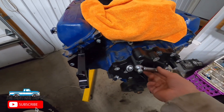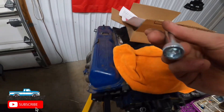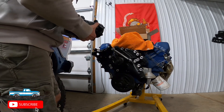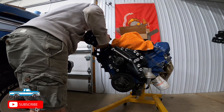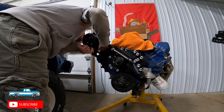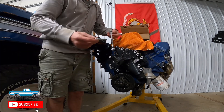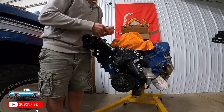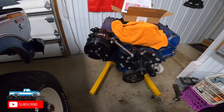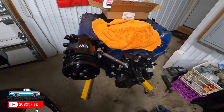I just have that on hand tight right there. This is the other bracket that goes up once you have the compressor on — and then the long bolt that's going to go into the bottom of the compressor. For right now I'm installing the compressor with the lines facing away from the engine. Now I'm using the one bolt that's left to attach the final support bracket, leaving it loose for now for mock-up purposes. That's really like five to ten minutes of work right there. CVF also does recommend that you leave those loose until you have everything assembled. Now we're going to move on to the alternator bracket.